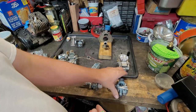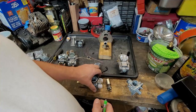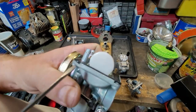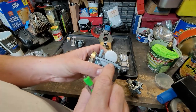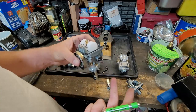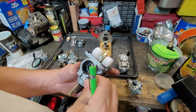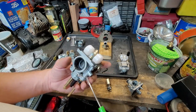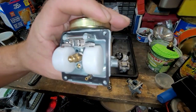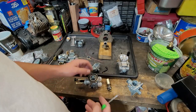The carburetor float adjustment on these is not the same as your Mikuni. If you look in your manual to adjust it that way, it is not the same. These are basically straight — you want to make sure the float is parallel with the base, that's all. There's no specialty adjustment like you'd find on a KE-100; just because it's for the bike doesn't make it the same. The other problem with this carburetor is you don't know what these jets are — they are not marked at all. There is no marking on those jets, so you have no idea what jet size it is.